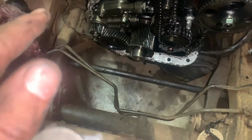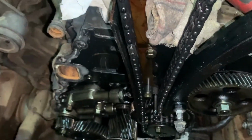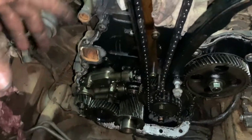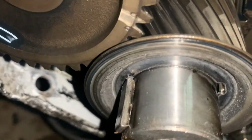Let me get into a bit more detail in a bit. So I'll quickly pick up all the bolts and then we'll get back. And there we have it, guys. This is the inside of a Mitsubishi 4M40. Well, not the inside. It's just the timing cover. But yeah, here's our crank. Here's where the oil pump sits. And there's one timing mark over there. Then you figure out where the other timing mark is over here on this thing.